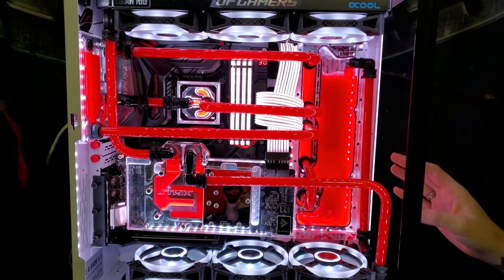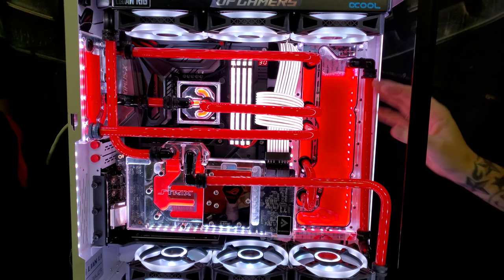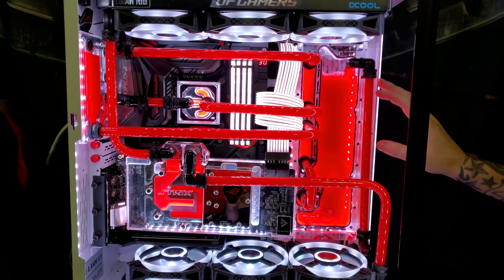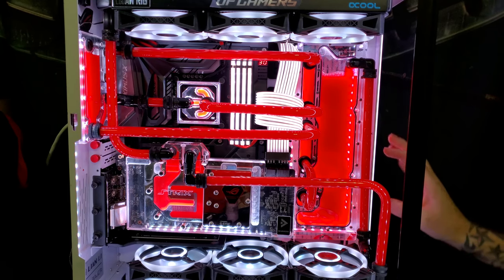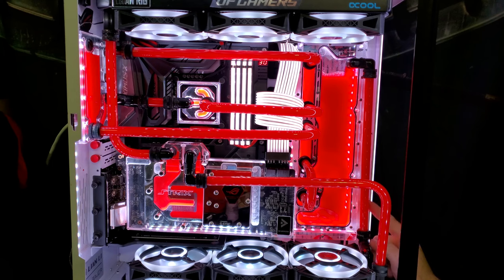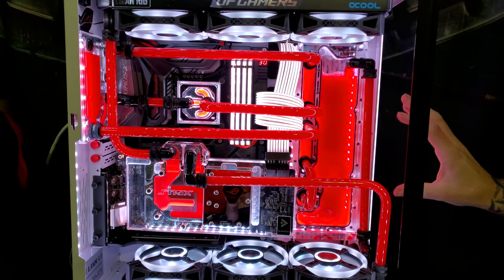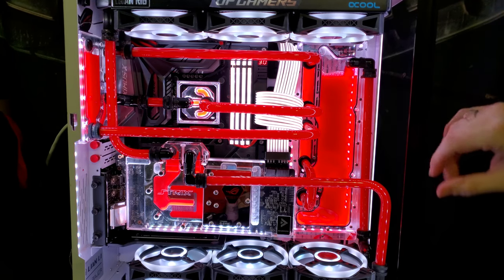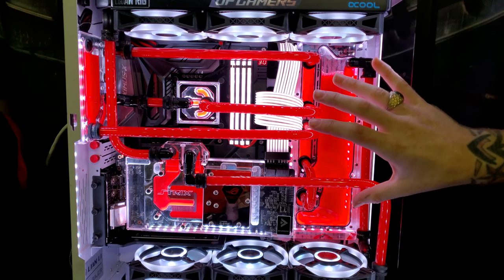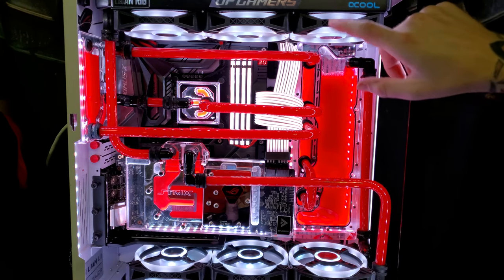I was going to go with just a standard box-store distro plate, but after checking out his videos and pictures I decided to go with this, and I'm glad I did because it is extremely nice and extremely well built. I have a Swiftech D5 PWM pump mounted back there running at about 45–50%, and my flow rate is great, especially with two blocks and two 360 millimeter radiators. The bottom radiator is 30 millimeters thick and the top radiator is 45 millimeters thick.